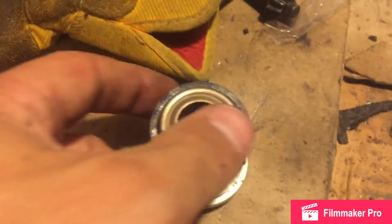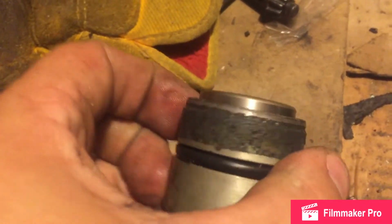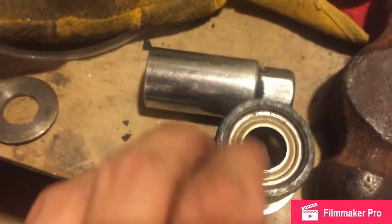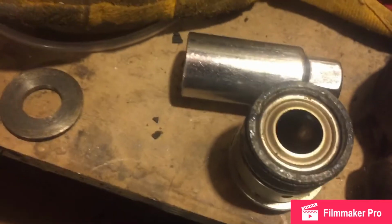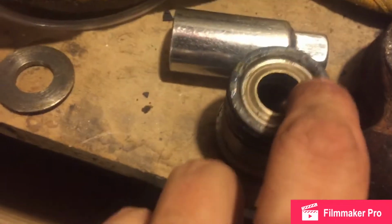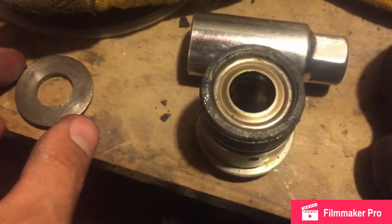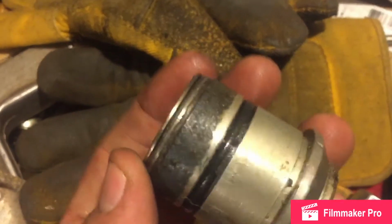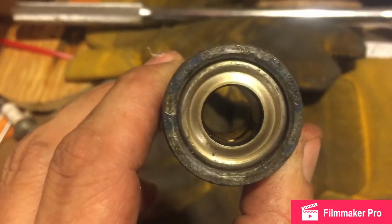I've inserted the seal and I've pushed it in as far as I can push it, just to make sure that it's going in evenly. As you may or may not know, you want your seal to go in as straight as possible, obviously. But what happens if it doesn't? Well, you either have to pry it out and start all over with a new seal. Luckily, the 18 horsepower, which again I have not seen on other models, has a washer assembly at the end of it. So it was crooked, straight up crooked. When I put the washer in, one hand was up. So with the help of the washer, I put the socket back on top, and the washer can only go so far on this end, so it straightened it out on the other side. And now we got a nice flush washer assembly with the seal now straight and beautiful.